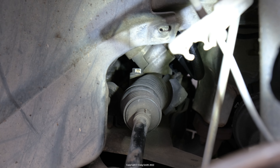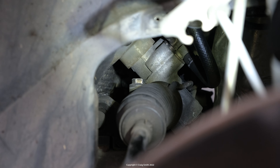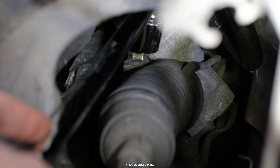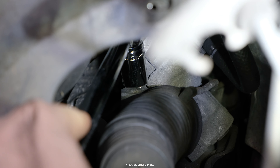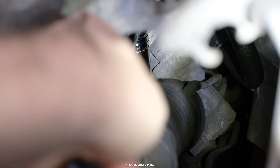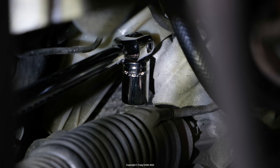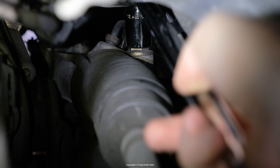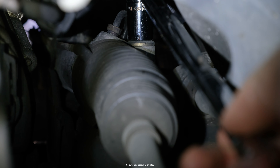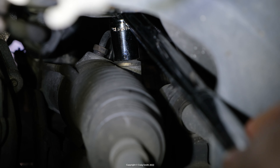On most front-wheel-drive cars the rack is bolted in place on top of the cross frame and it's pretty inaccessible to start with. I wanted to check I could loosen those bolts before doing other work, as I knew they're seriously torqued tight — but I found I couldn't even get a basic socket and bar onto them. On the steering side the bar hits the plastic shrouding, and on the other side there's just no room to turn it. So I need to lower it all down, which is necessary anyway to make enough room to get the rack out later.